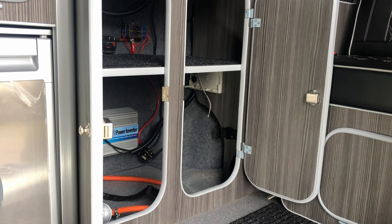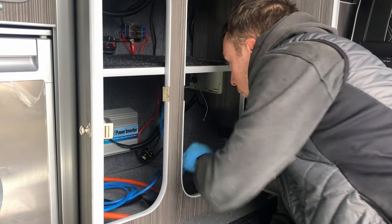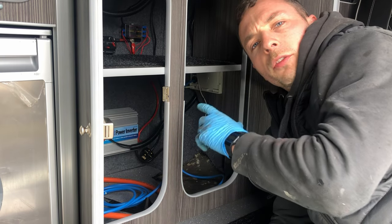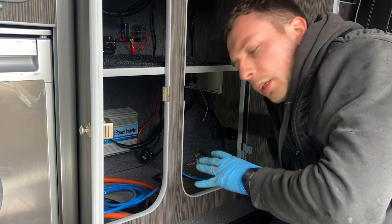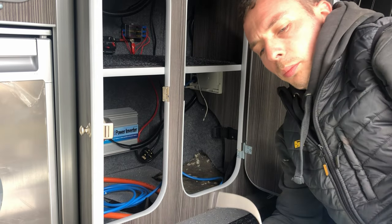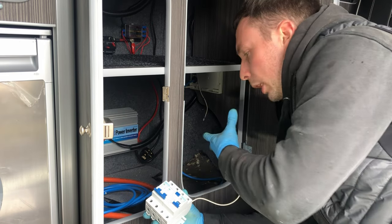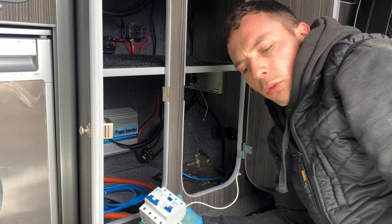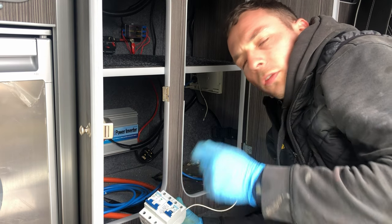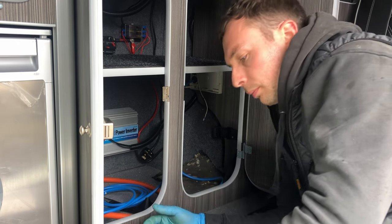What I'm going to do is I'm going to push the wiring through from the hookup plug that we wired in earlier. So I've now pulled the wire through, as you can see, from inside the cupboard there, and I've just lightly cable tied it in place where I want it to go, just so I know that I've got the right amount of routing. So now what I'm going to look at doing is putting the RCD and such back onto the baseboard there, and then mocking up roughly where I want the wiring to go, and then I can cut it to length. And what I am going to do also is I'm going to look at soldering the ends, so that I can just fold them over and put them into the bottom here, and I'll get a nice tight connection, but we can go through that.